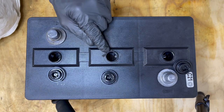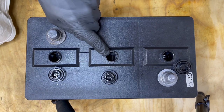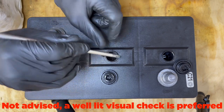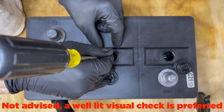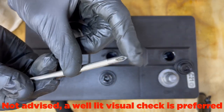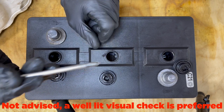Now since it is really tough to gauge where the fluid is compared to where this fill hole actually ends, sometimes you can take something — make sure it's clean first — and just kind of slide it down the plastic tab until you feel it give way. Then you know you're at the bottom; don't go any further. Pull it out and see if the tip is wet, which this one is slightly. So we're pretty much right at the level that we should be. If it's not wet, fill it up to that level.